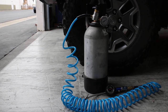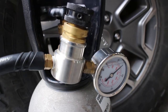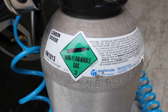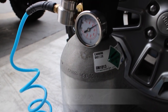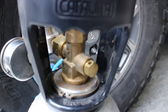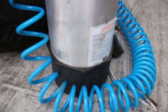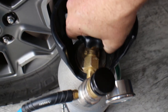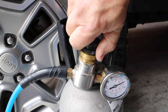Last up is a DIY-built CO2 tire inflation system that my buddy has. You can buy purpose-built tire air bottle systems, but they'll run you $400 to $600. This DIY system costs just a little over $230. He built it using a 10 lb CO2 bottle from a beverage store and some regulators and attachments you can find online — I'll leave links in the description. He says it costs him about $20 to recharge the CO2 bottle at his local liquor store, and he can inflate all four 37-inch tires four times each.